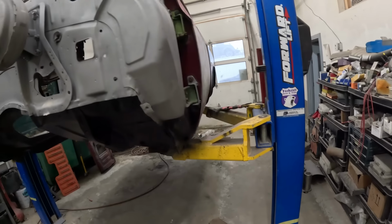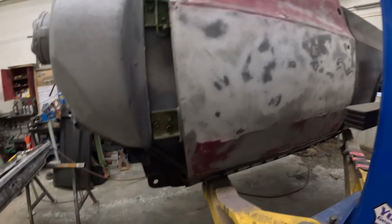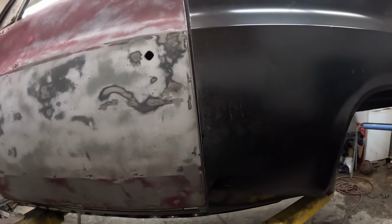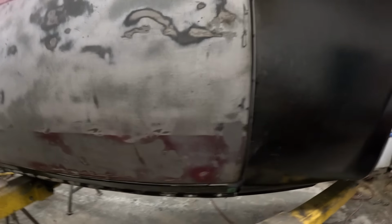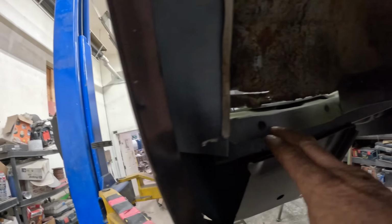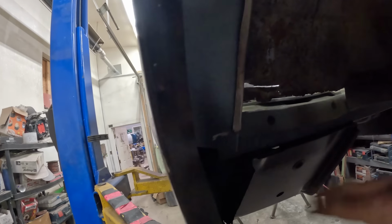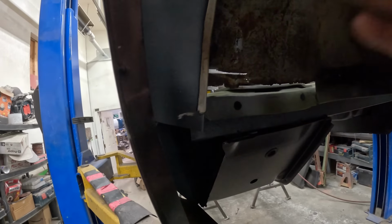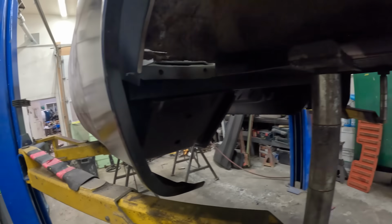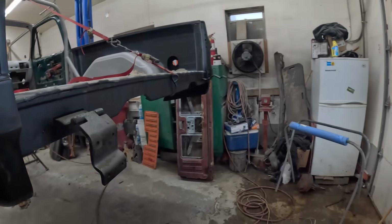Anyway, we're still waiting for a body mount kit for the 74 Blazer, but today we're gonna drop it down. I'm just doing a little quick sanding on the doors, just so when I prime the rest of it, we want it to be all one color. We can't finish welding these two pieces until we get the body mounted, because we're gonna cut these off here and make new ones, but we can't really flex it, so we don't want to drill the holes and bolt it until we actually get the body mounted down on it, so we know where it's going. Get that done hopefully this afternoon.